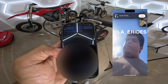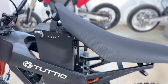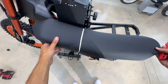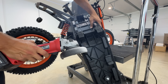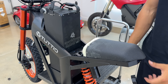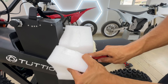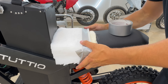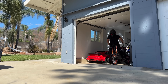I thought the battery would barely fit but it actually has too much wiggle room. It now plugs right in and I'm able to change the tune to 72 volts and increase the power through the app with direction from Lae Rides. The only problem is the battery just barely stops the seat from closing, so I need to trim a little bit off the seat, marking an accurate line for where I'll cut. My measuring was pretty good — just a hair off — so I filled the space with some foam. You won't notice it's there. A couple straps and voilà — a 72-volt hacked Tudio ready for the street.